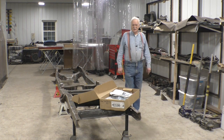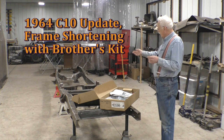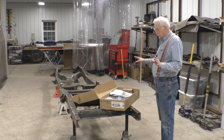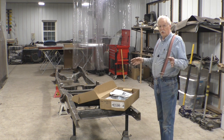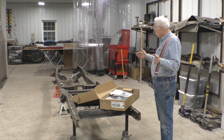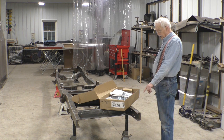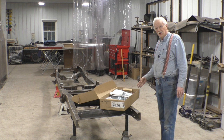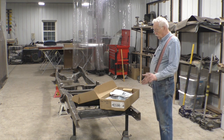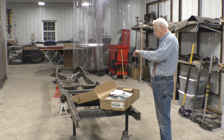Hello, welcome back. Last time you saw the frame, we were straightening it. We've gotten all the I-beam off and all the trusses that we welded to the frame off, cleaned it up, dressed it up. Now what are we going to do? We're going to cut it in half. We're going to shorten it — 12 inches in the front and six inches in the back — for a total of 18 inches, which will make it a short bed truck.